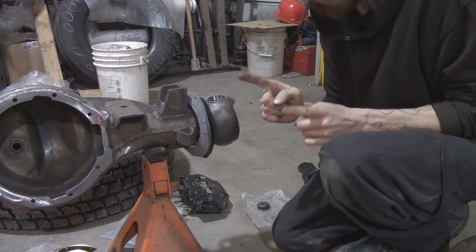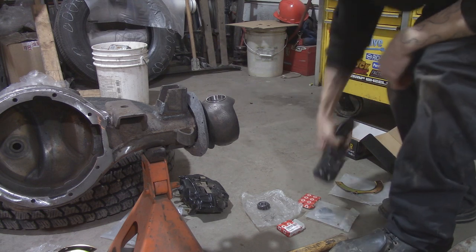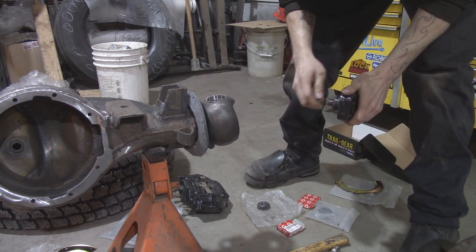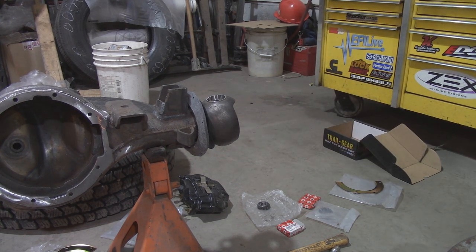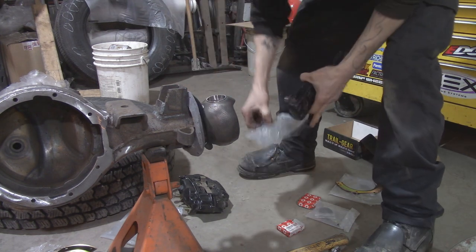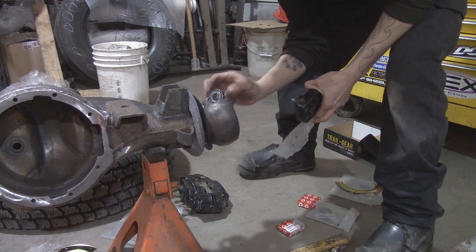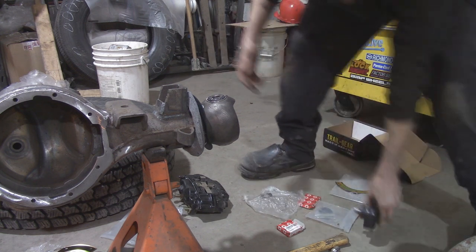There. Now we're ready for the knuckle. Make sure you got your top part ready to go. I do not, because I didn't sand that yet. I'll sand this and then we'll pick up. All right, so step the first, get all your felts and wipers on. Second step, put your bearing into the top there, just like that.